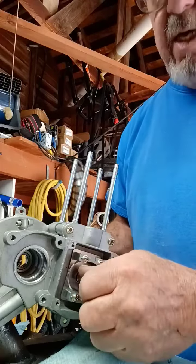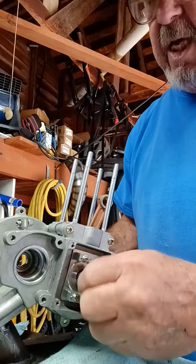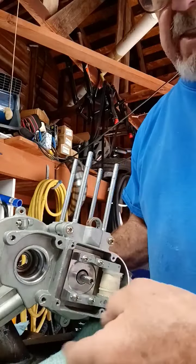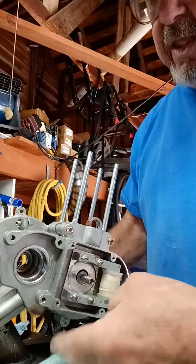The crank is coming up in the front and down in the back. You need to really concentrate on what you're doing, because some guys are thinking the back side is where the crank turns — no, it doesn't. I mean it will turn that way, but that's not the general direction. It turns from this side clockwise, therefore it's coming up in the front, not the back.